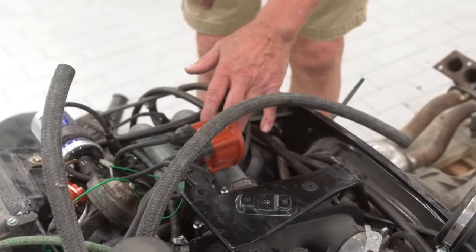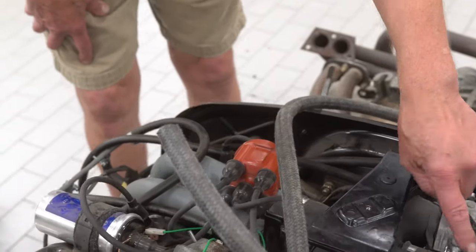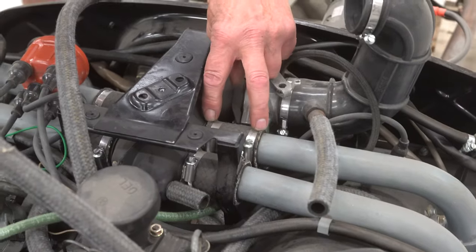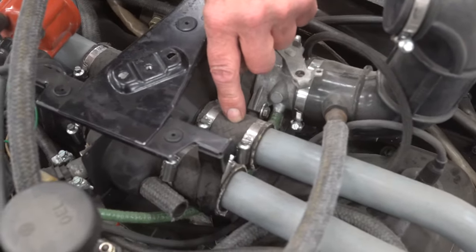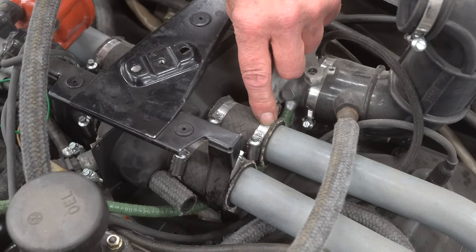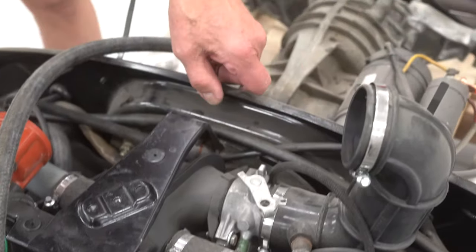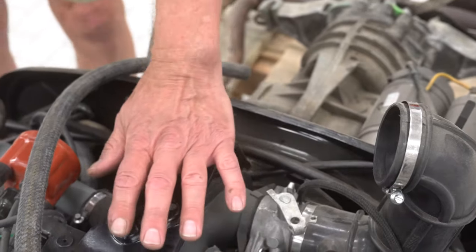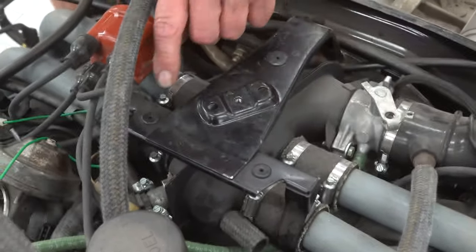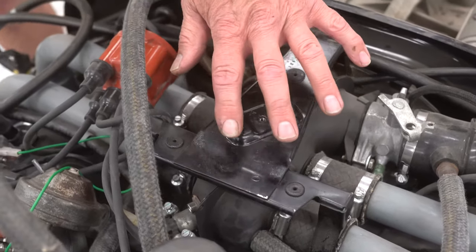The intake runners are from the factory painted with zinc paint — it's a powdery paint to avoid rust, so these are the correct color for the intakes. The original intake boots were smaller than these but they've been discontinued, hence we have put clamps on them — these clamps were not factory correct. The sheet metal is always painted semi-gloss, not gloss, not flat, but semi-gloss. You can see the 1.7 air cleaner stand with three rubber buffers so that it won't squeak and rub.